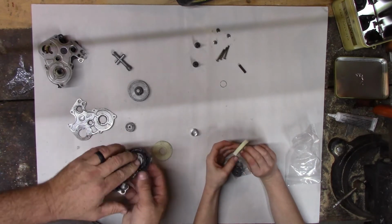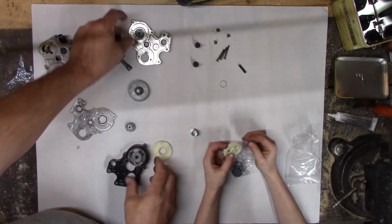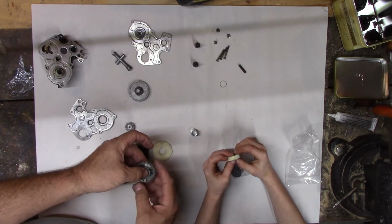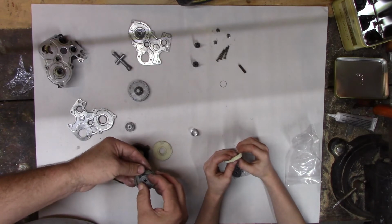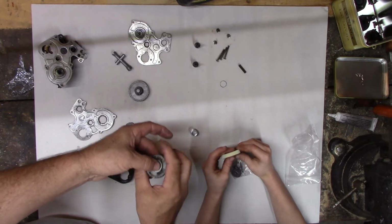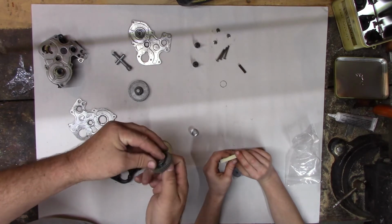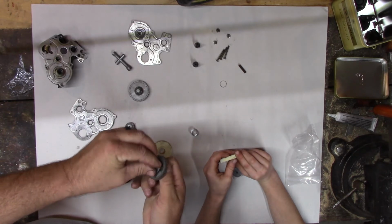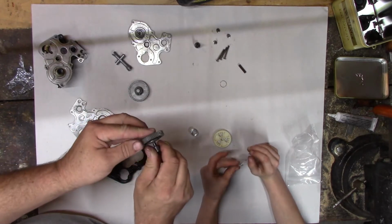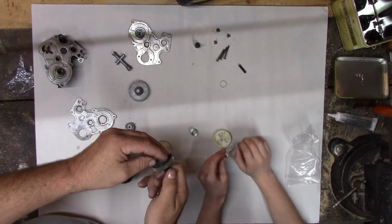How does a few bevel gears make the differential work? Because they have to spin all of them together to work. See, when you take this gear out of here, you got a bevel gear there. When you turn this gear, they lock up. See, it has to turn both of them because they can't turn independently. The only way bevel gears can turn is opposite each other. See that? So what happens is, as long as it's turning this gear, they'll both turn, right? But as soon as one of these wheels starts to not turn, then it can spin independently like this, separately. So it's just the way it works, but this one doesn't work as good as some of them could. But what are you going to do? Here, see? So when this wheel turns, that wheel turns, it can not turn the big gear. It doesn't have to turn the big gear, right?